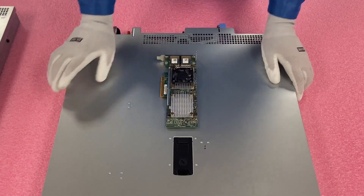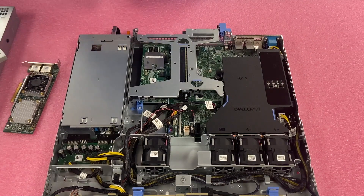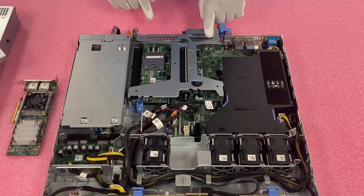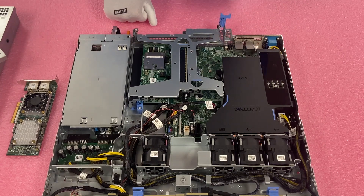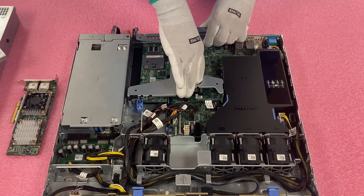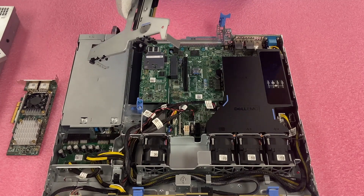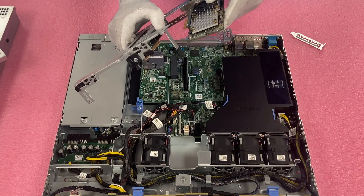All right, so now we are going to install our cards. First things first, you're just going to pop the latch and lift the top just like any Dell server you've been in before. Because my card is low profile, we're going to put it on this side. There's technically a low profile and a high profile option. So we're going to lift the blue, pull our riser straight up, and we are going to install it right here. First thing I'm going to do is actually remove the current bracket so that we can install our new one.